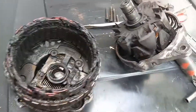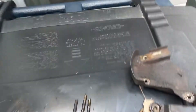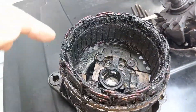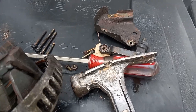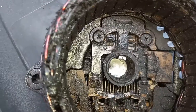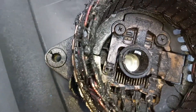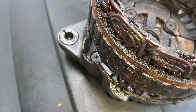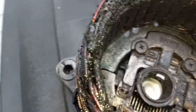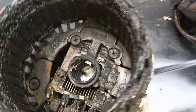That took longer than I thought. I had to hammer it apart because it just wasn't budging. I can show you the problems — it's broken, too far gone to save. I've got a broken screw here — see that one that's shorter than the others? That's one of the four post screws that goes around to hold the alternator together. You take those out after you remove the back cover and the electrical positive terminal. Inside there, you can see that shiny metal — that's the brush, right there. There are supposed to be two of them, but the other one is worn down so far it won't make contact. That's part of the problem.